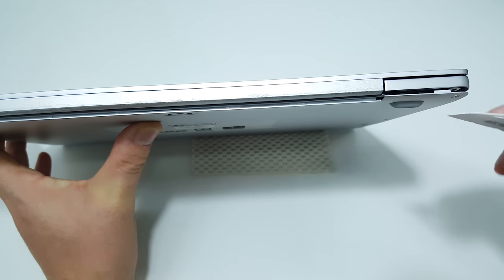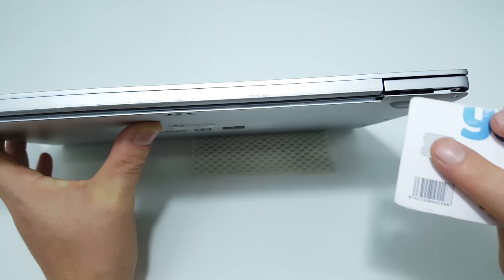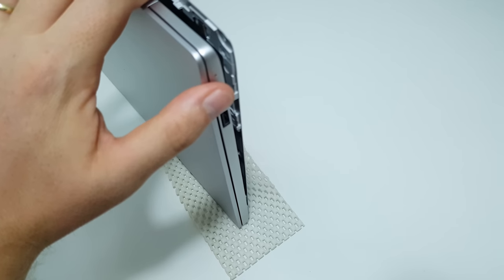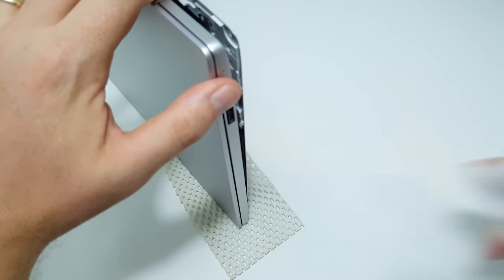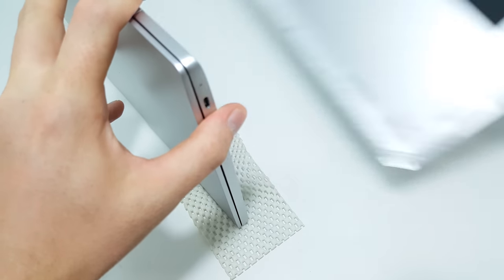Just take your time and go along very carefully and try not to damage the aluminium. If you use something like a knife, you will definitely scratch and damage it. The front left and right sides have quite tight clips, so just take your time and unclip those on either side, then push down and pry the lid off.